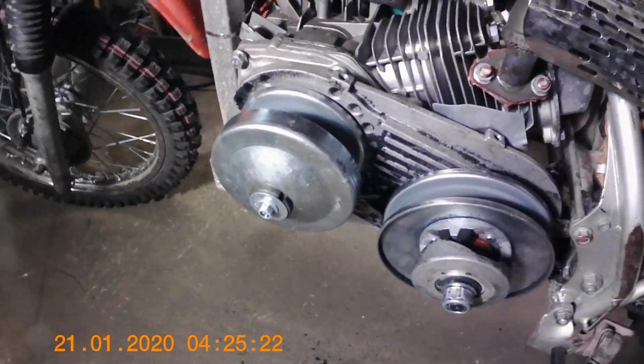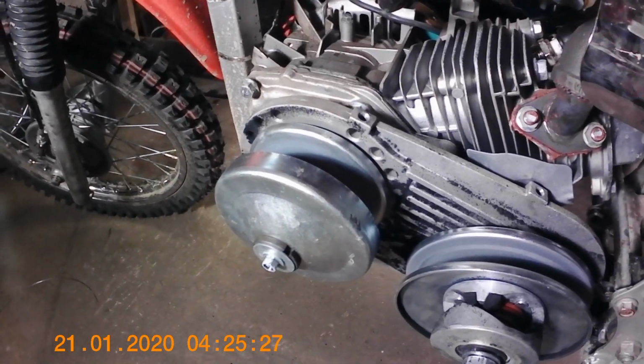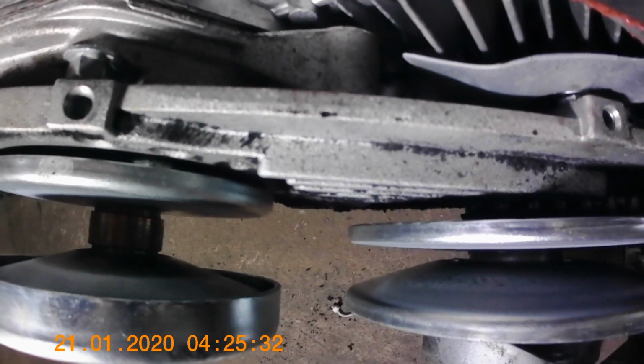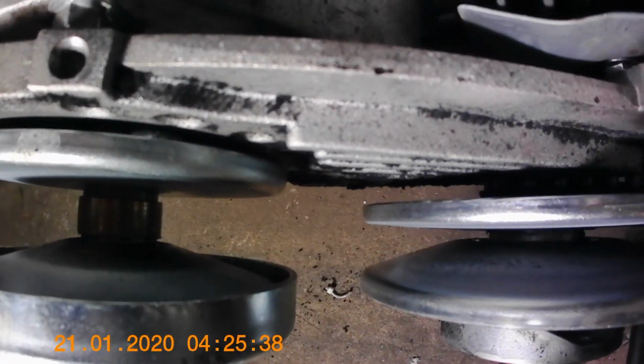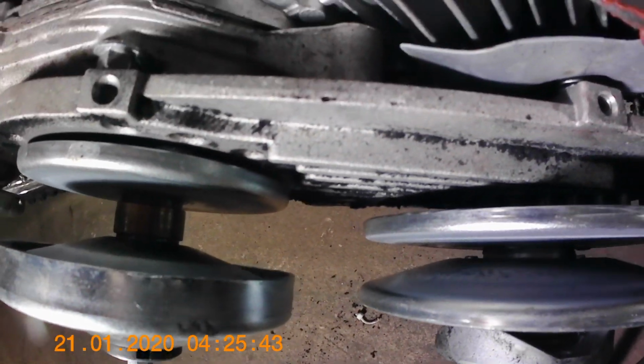My biggest problem I'm having is the shaft on the motor is actually only about 2.5 or 2 3/4 inch long. It should be 3. Because I had to remove the spacer behind it, which I knew was a bad idea, but I did it anyway, these pulleys don't line up, and so it kills a belt really fast. And so that's exactly what happened.